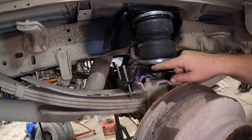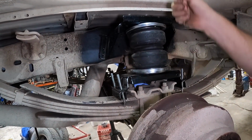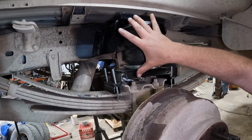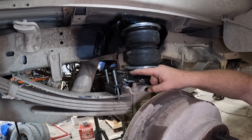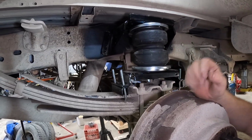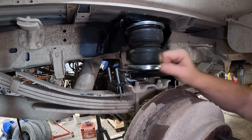And remember, you need to have between 5 and 7 inches between these 2 brackets. So we're gonna use a pry bar to get it into shape and mark all our holes. We're gonna set ours at exactly 6 inches. So between the top of this plate and the bottom of that one, we will be right at 6 inches, right in the middle of their specifications. Let's get some bolts on this bottom plate.